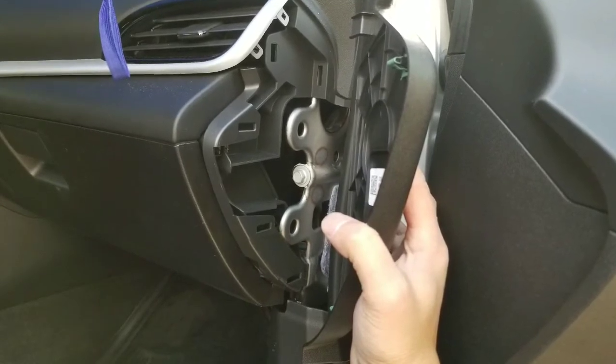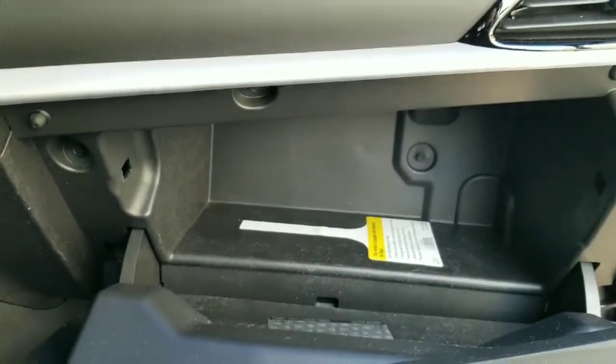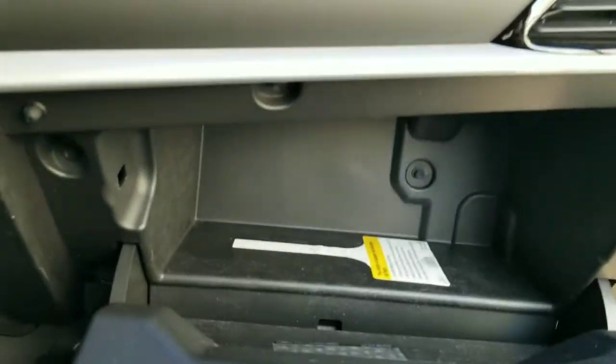You have to remove the side panel. Just remember when you put the side panel back in, you slip it in underneath the weather strip first when you're reinstalling. After you take the entire glove box off it should open and close like normal. There are roughly five of those screw bolts that are holding up this glove box.